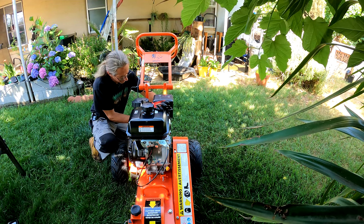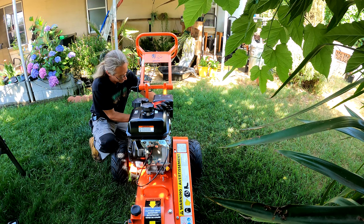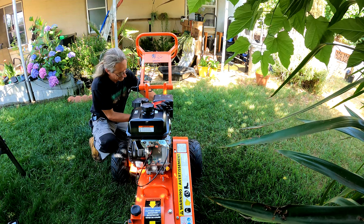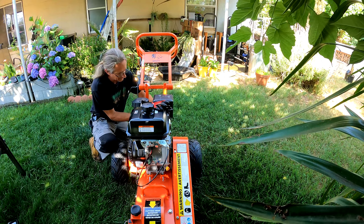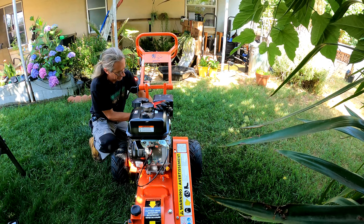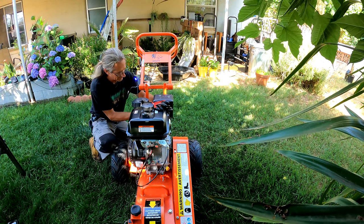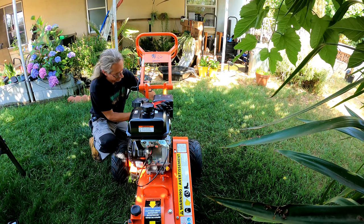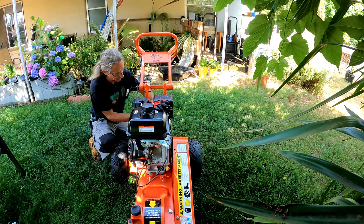So the hour meters that I've been used to in the past, they have like a solid copper wire that goes around the spark plug. This is a loose, braided copper wire. The other ones just form to the wire as you wrap them around. This is not forming to the wire. So that's kind of a pain in the rear, but we'll manage it.